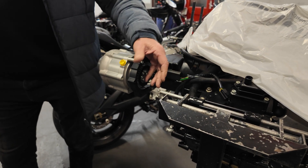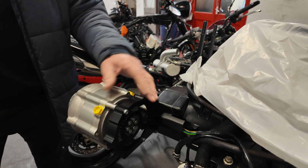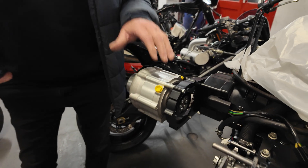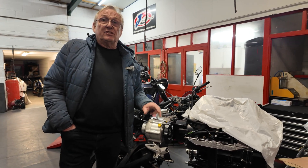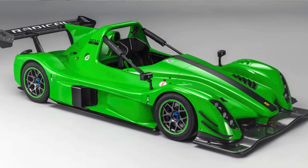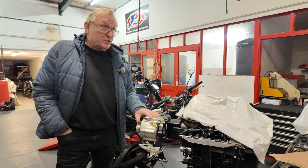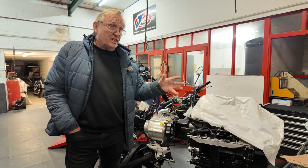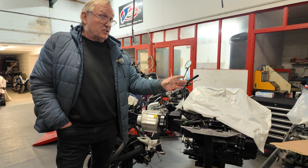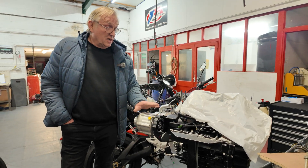With the Radical, the supercharger won't fit on the gear drivetrain side but fits perfectly on the other side. The only things in the way are a couple of water pipes which can be easily redirected, and the exhaust system comes around away from the supercharger, making this location extremely good and easy to fit. In the new year we'll be fitting this to a Radical SR3 — probably running a C30-74 for around 300 horsepower, or a C30-94P for around 400 — though a supercharged 1300 is likely more durable and powerful than a stressed 1500.